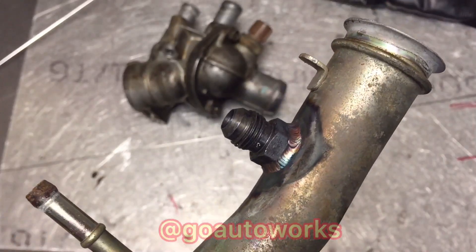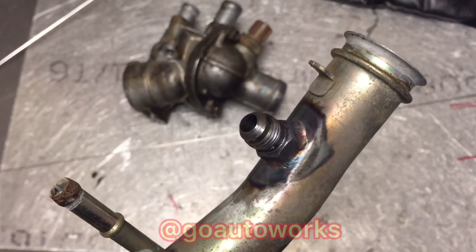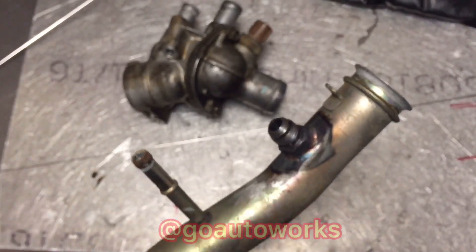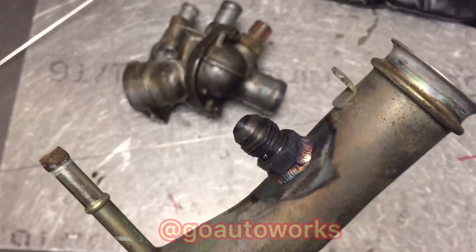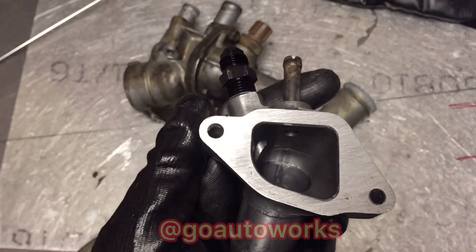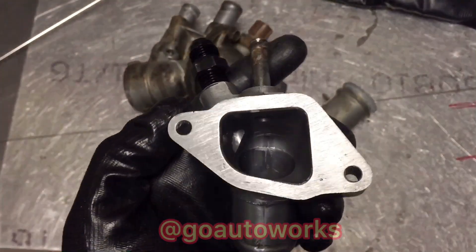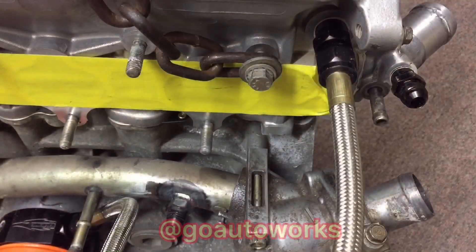The water pipe is all welded up — it's still a bit warm so I'm hitting it with some water to cool it off, then I'll get the o-rings put back on. Before going back to the motor, I sanded the mating surface back fresh and clean and will put a new coat of sealant on it so you get a flat and leak-free seal.